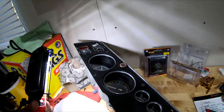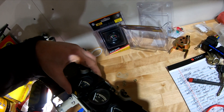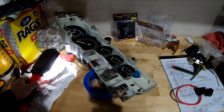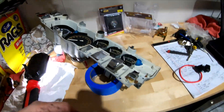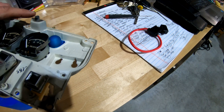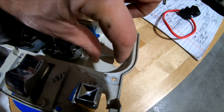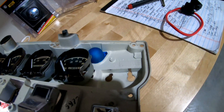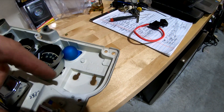I got the dash cluster out of the '68. You flip it over, take the trim panel off, then take the little bezel cluster out. You basically undo the alternator gauge — it's got some screws or nuts on the back. I had to modify my bezel a little bit — I actually had to move the holes up, so I drilled new holes. That way the new Autometer gauge moves up slightly, more in line where I want it to be. It only goes up a certain amount before it bottoms out on the bottom.